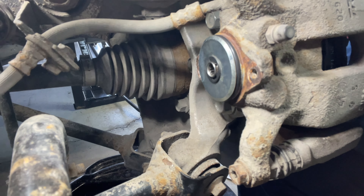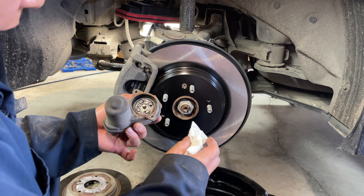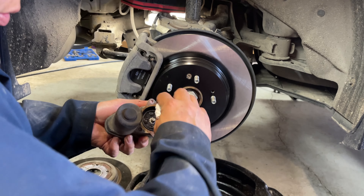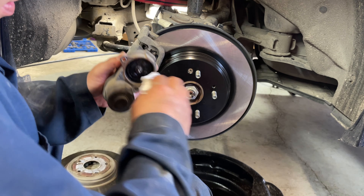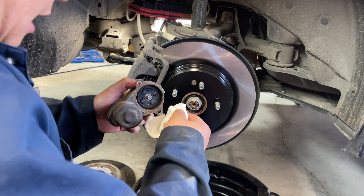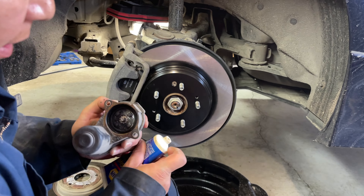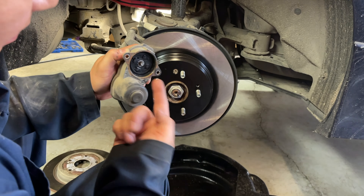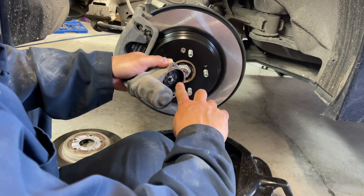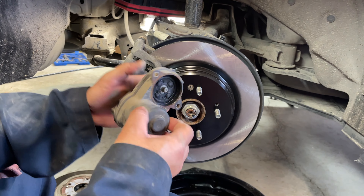The O-ring just has a slight sheen — you can barely see it. Using a clean paper towel, clean out the dirt from the actuator and make sure the connector is clean. Apply an ultra tiny amount of Sil-Glide to the inside of the actuator to help the seal slide on properly and keep it water tight — again just a slight shine with no excess residue. Then reinstall the actuator to the back side of the caliper.